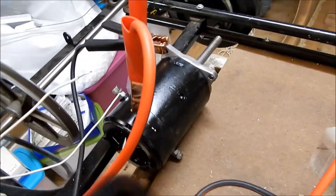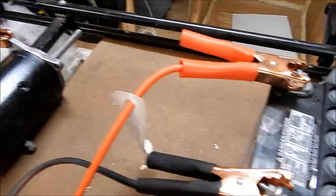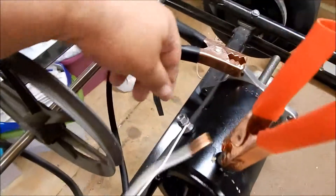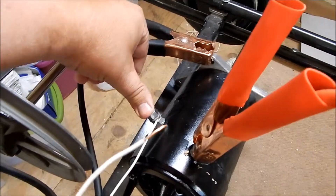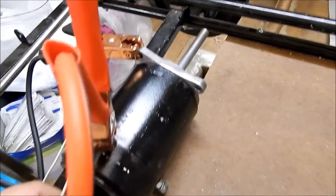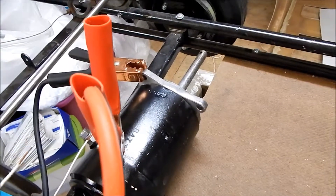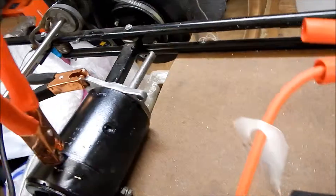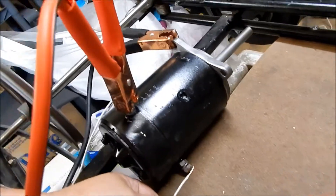In the actual operation of the vehicle, I believe this goes through the accelerator switch on the floor. Over here, I've connected a lead to the brush's end, and by jumping it to the battery terminal, you get clockwise rotation going from this way. Now, if I go down here to the fields with the same lead and jump there, it goes the opposite direction.